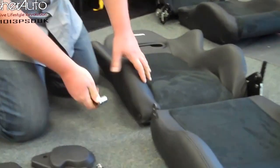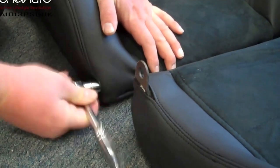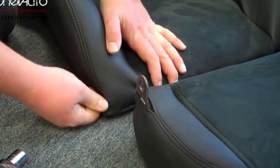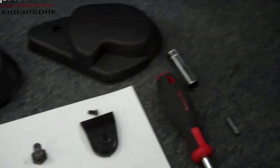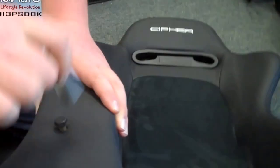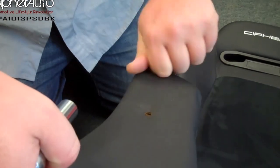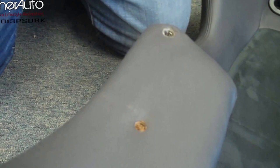Let's get the hardware off that comes with the seat already pre-installed. That's one of the bolts — you're done with that socket for now. Then use the 13mm socket to pull out the two bolts for the reclining mechanism. Now we have our holes ready to go.